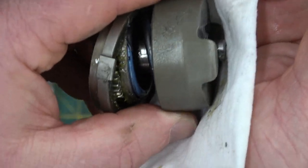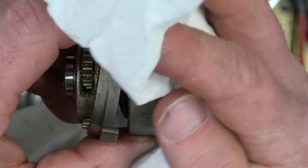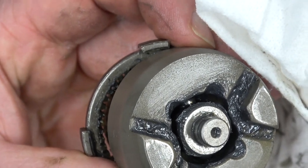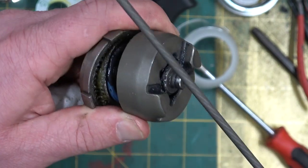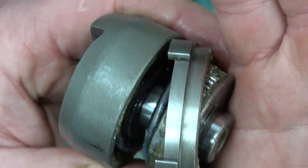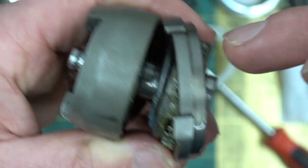Looking at this now, looking a little closer, it appears to be forged, but they've gone through the additional step of coating it in some sort of copper goo, copper-esque goo. Yeah, you can see that. That's forged there. This being a Japanese tool, we'll have to pixelate this out, but hard as a wedding prick. Leaning close and looking real carefully, you can see the difference in the texture between the sintered metal part and the forged part. Forged, sintered.